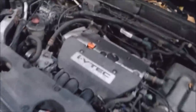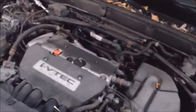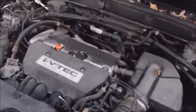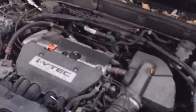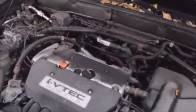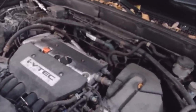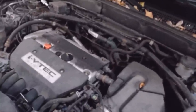Fun code, 2004 CRV. I've had this thing in here — it keeps coming back on me, it must be in love with me. This thing's got a camshaft actuator problem, it's not that uncommon. First thing I want to do — I don't even bother testing these — I take them out and make sure they're not all gummed up with oil. Check the oil: it's a little low but it's good enough, should be producing enough oil pressure to make it work. So I'm going to take this thing out, inspect it, and make sure it's not all coked up with carbon deposits. If it's clean I'm just going to replace it. Sometimes it pulls this code because it'll try to open up the valve and there's no oil pressure flow going into it to make anything work, so it could be plugged or it could just be bad.